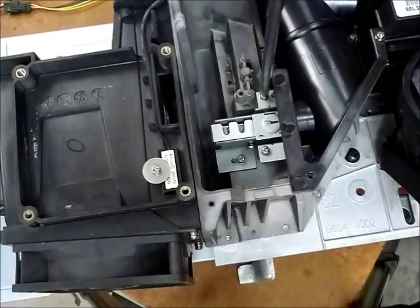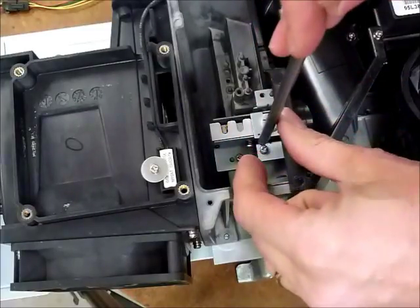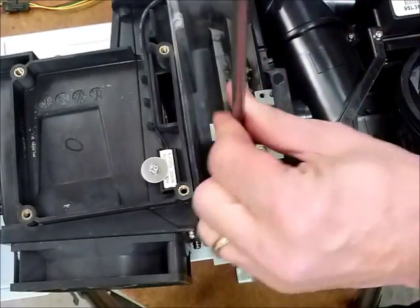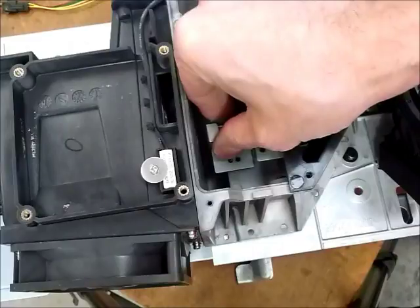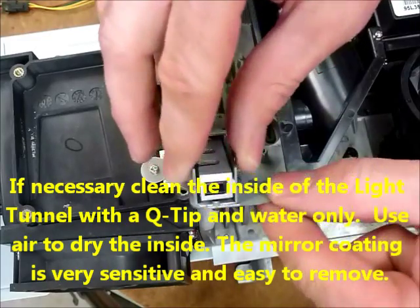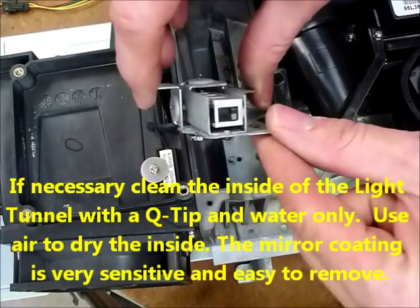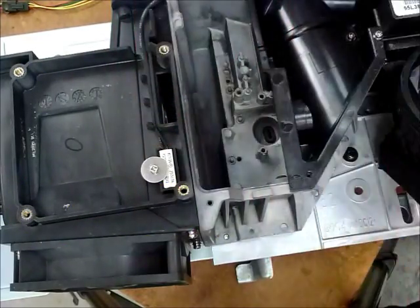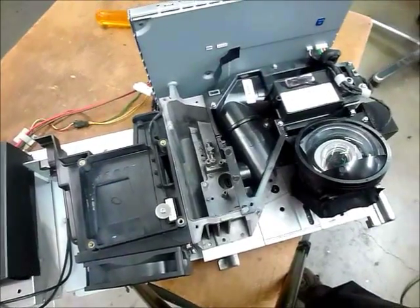On this model we're also going to remove the light tunnel assembly — three screws. The light tunnel assembly can be lifted out as well. There's the light tunnel where all the light shines down through. This one's actually not in bad shape — I've seen some where the inside of the light tunnel was white with all the haze, which will severely obstruct the amount of light entering the DLP chip. Next we're going to get into disassembly of the engine itself to do the repairs and prevent this from happening in the future.